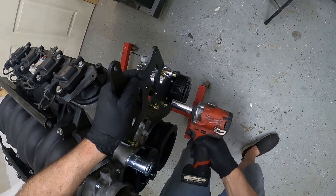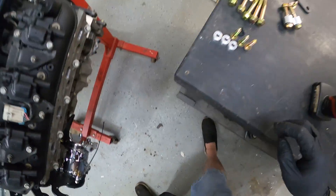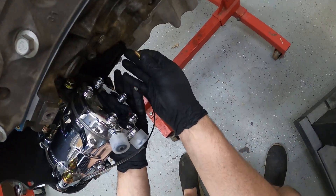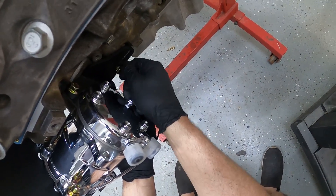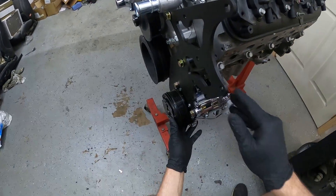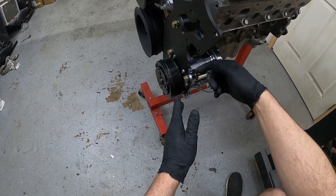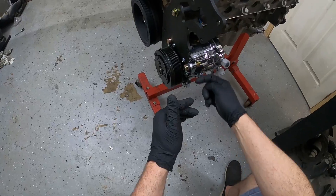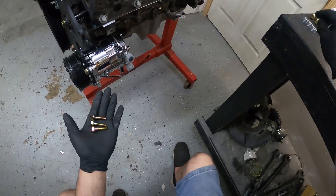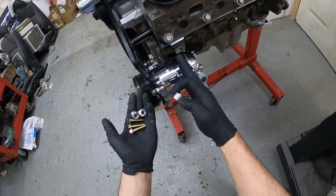We want to leave all of this stuff loose until we get all the hardware in place. Now go ahead and use the small M8 bolt, which will mount the rear compressor bracket into the block. Leave this loose for now. At this point in the chassis, go ahead and get your power steering pump up in location — the lines will clear. You'll have to modify the lower line by bending it to go around the compressor, but it'll fit right in this location. It's mounted using three M8 bolts and three half inch spacers. These half inch spacers go between the back of the plate and the power steering pump to correctly align the belt.